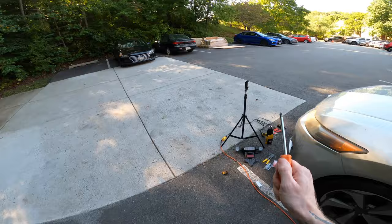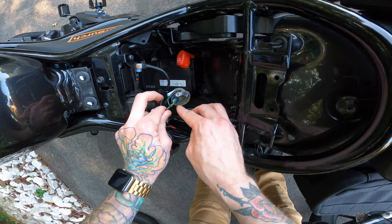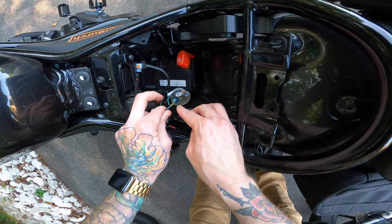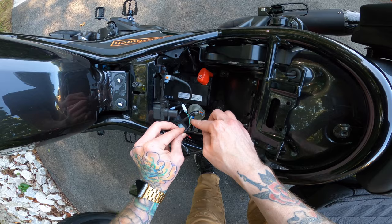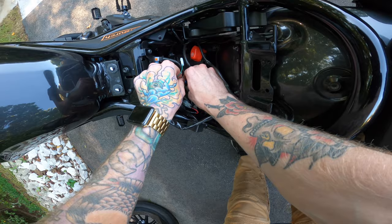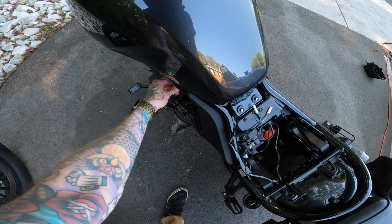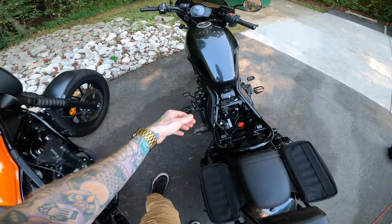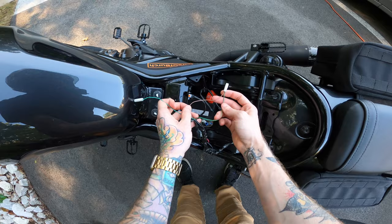Alright, now we'll wire in the diode, which is easy also but not quite plug and play. The wire we're looking for is going to be in this little bundle right here — it's going to be the green wire with the yellow stripe. It'll be in the blue plug next to the brown wire. The convenient thing is the diode has to go in line with that green and yellow striped wire, but it doesn't matter where exactly, as long as it's before it splits out to the tail light. So we can do it right from underneath the seat — we don't have to take everything else apart. Mine is wrapped with a bit of electrical tape, so I'm going to take that off so I can slide the casing further back to expose more wire and have more to work with.